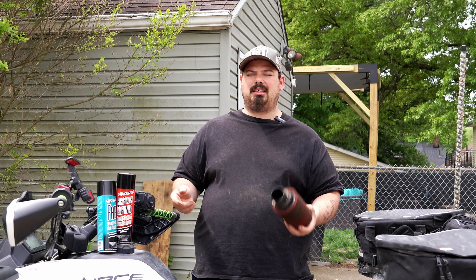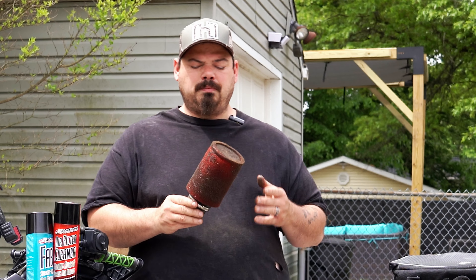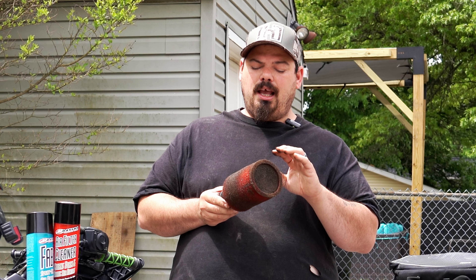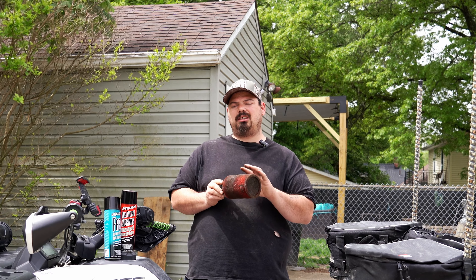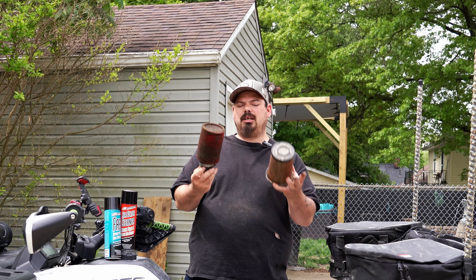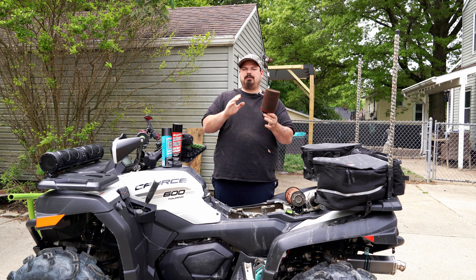If you don't get a good quality filter you'll have those issues. I'm not here to mislead you — run what you want in your machine. I know mine's safe because I know what I run. A lot of you are running K&N — K&N is fine if you're not in a really dusty environment, if you're on the road. But here's the thing about K&N: yeah, they flow better, but they don't catch as small of particles as an oiled foam filter does, and they'll also clog up. What you might think looks clogged on this one, I assure you it's still breathing properly because of how the oil catches the dust and dirt.